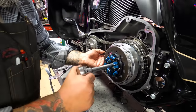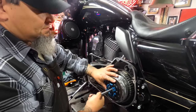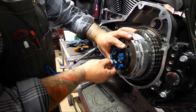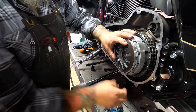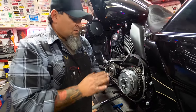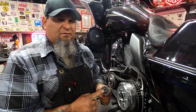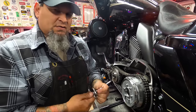Install the positioning bar. Left-handed thread — 80 foot-pounds. Now we will have to remove the pressure plate to get our socket back out, install our clutch adjusting screw and move forward from there. So I've taken the pressure plate loose to get the socket out. This is torqued now. Now we can install our clutch adjuster. Because we have not changed anything in the clutch components, the adjustment that's already been determined does not have to be changed. Just install the piece as it came apart.